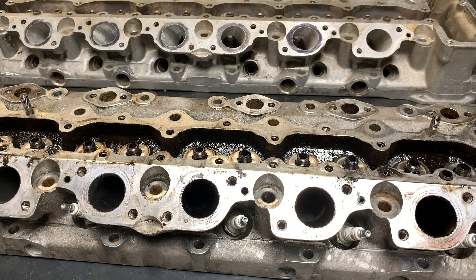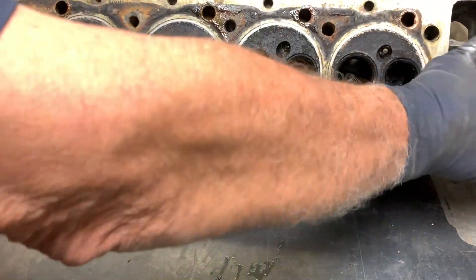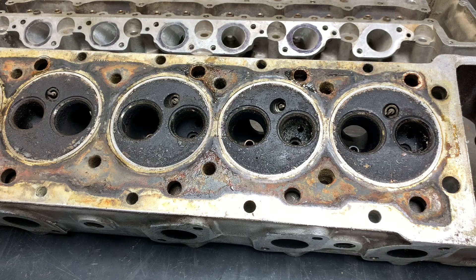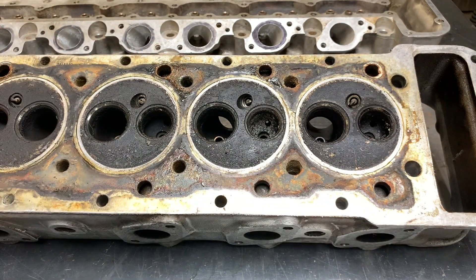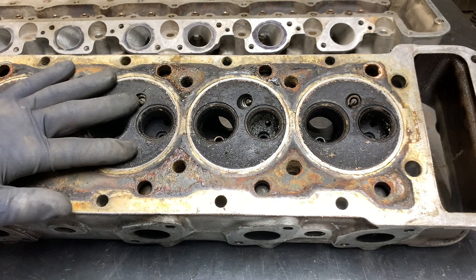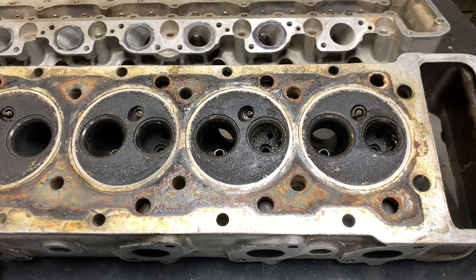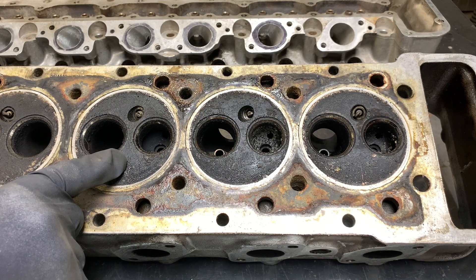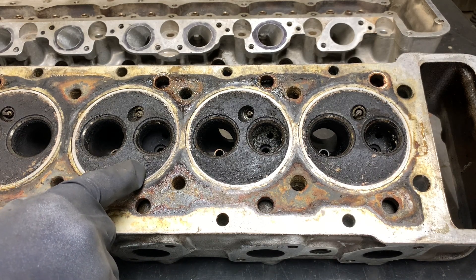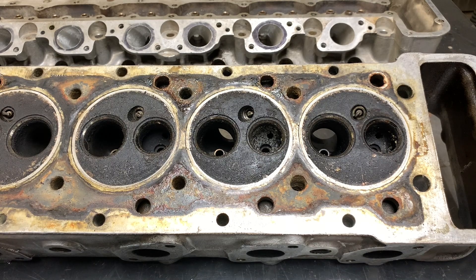The really big difference between these heads is on the underside. Looking at the pre-HE, the bottom of the cylinder head is just one straight flat cut. The valves will be slightly different lengths because of the different combustion chamber design, but this is what the pre-HE looks like — not particularly sophisticated. There's no combustion chamber in the head itself because there's a dish at the top of the piston that serves as the combustion chamber, with a large squish area — about three-eighths of an inch wide — around the piston.